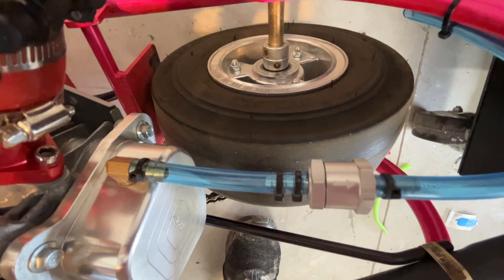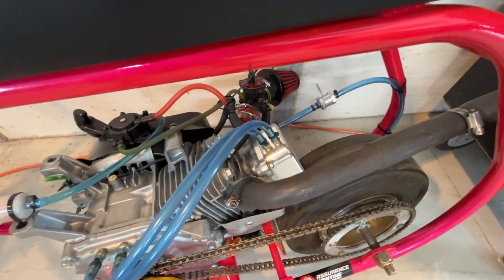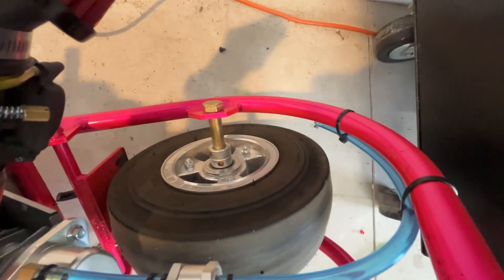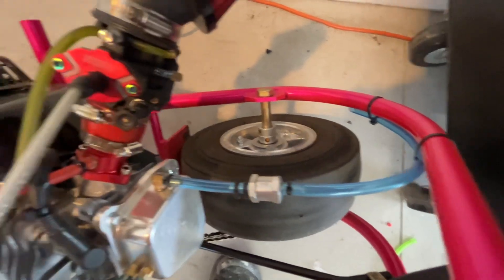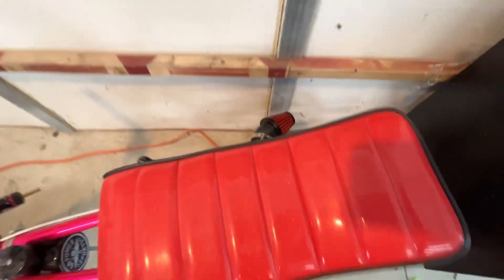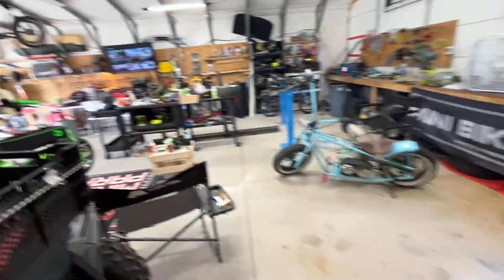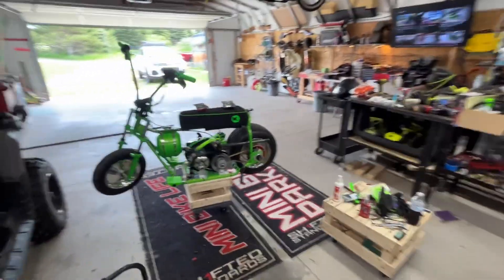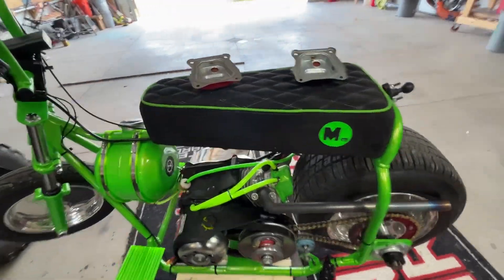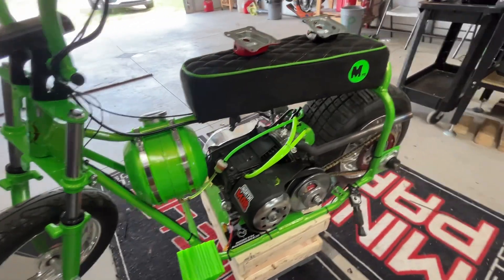See the valve cover? I get oil up into the valve cover, no problem, but I seem to never get any coming out of here. So I don't run a catch can and all that — I just run it out there. It never had any oil in it. A lot of guys put all this stuff on their bike that you really don't need, unless you're running methanol. If you're running methanol, your oil turns to soup and gets all over the place — that's the big reason they run those. But if you're just running gas like most people, you don't need that.